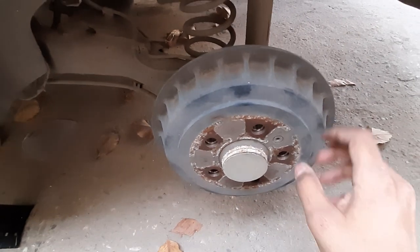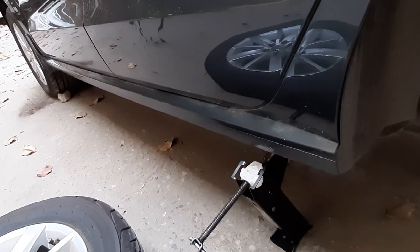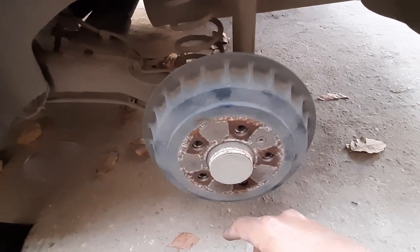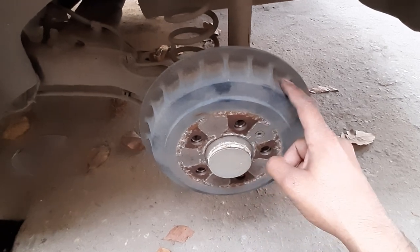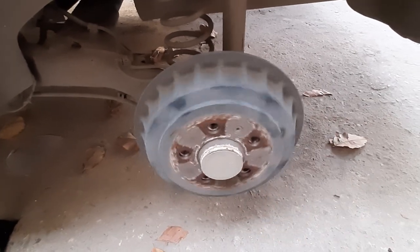After the wheel is removed, the next step is to release your handbrake. We will remove the rear wheels and chock the front wheels with the help of a brick. Then you have to rotate the drum — if it rotates easily, that is good. Like that, it rotates easily, so this is not seized.